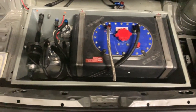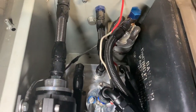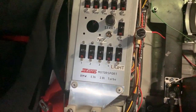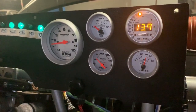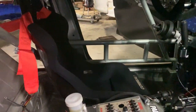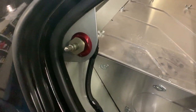This is the tank setup: ATL fuel cell with Bosch 044 pumps. The fans are located over here — these are the highest CFM Spal fans. You can see the fire extinguisher coming into the rear area, with the nozzle spraying on the fuel system when you pull the lever. That's where the hot air comes out. There's our standard switch panel — which you can buy on our website — featuring push fuses that also act as switches. The Chase Bays handbrake, which I'm super happy with. Autometer gauges and two lambda sensors: one controls the ECU and the other is completely standalone. I like to have all the relays within reach for the driver so if something weird happens you can swap them out quickly.